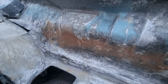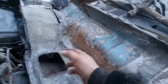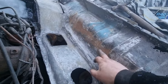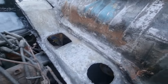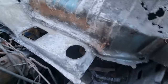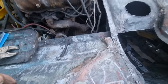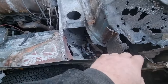I've used fiberglass filler — just the kind with strands in it. It's a lot more stronger. That isn't going anywhere. And I've also got a brace behind there on the inside — a metal brace that I made, basically a strip of metal welded on for extra support, which I'll seam seal. I've covered that in fiberglass as well. I'll put some more welds in there too. I've just got all that to grind. I've got the inner lip part of the weld on here.